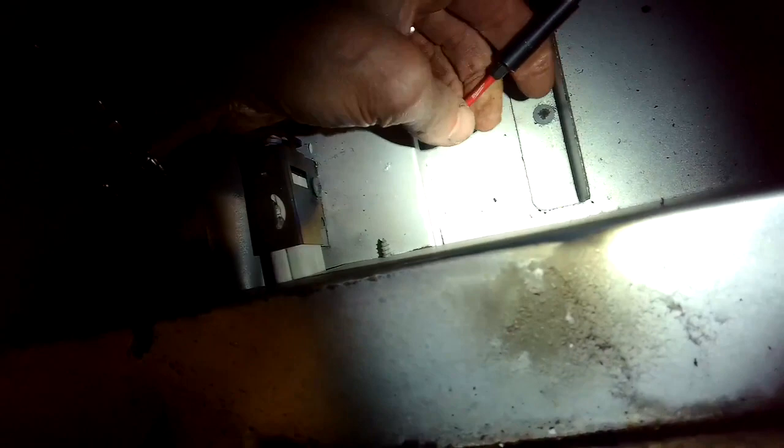There's the venturi tube, the burner tube, and the igniter is hooked to it. I'm going to use an angle tool to get in to two Phillips head screws here. I have an extension to make it a little bit easier — a small Phillips head screwdriver would work also. I'm just going to remove those two Phillips head screws.